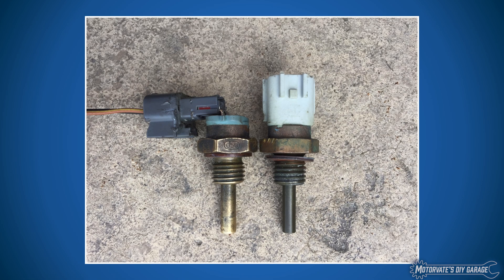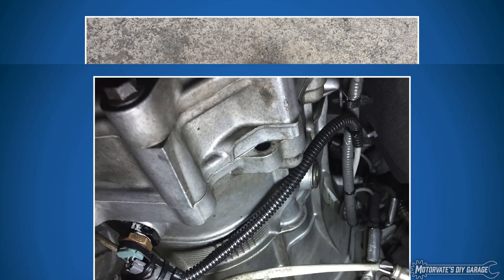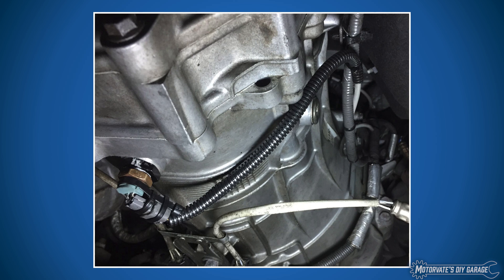So we needed a different solution. What we did is take our engine coolant sensor, which we can see right here, and modified it a bit — sliced it off and did some work to hook it up. Here is what the final part looks like. After the picture was taken, we taped it up very well to make it as weatherproof as possible. It's now as low profile as we can get it and no longer hanging down as the lowest part of the car. This wire goes up and connects to our Bluetooth sensor server.